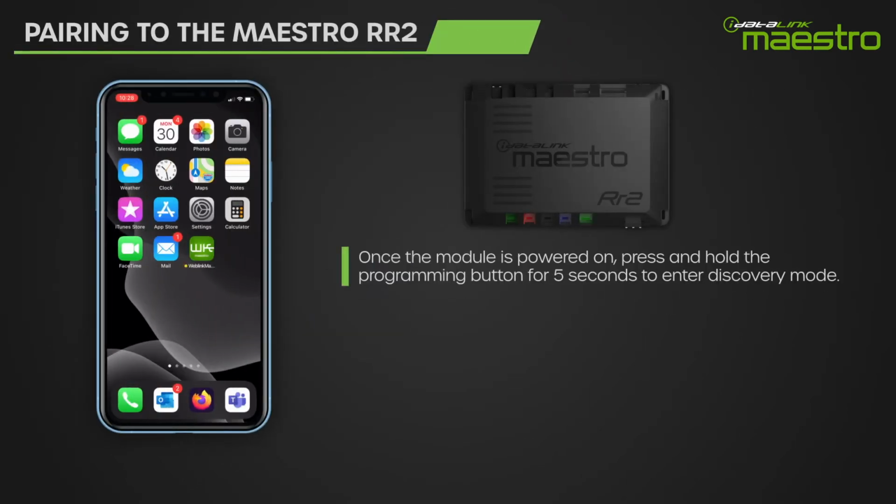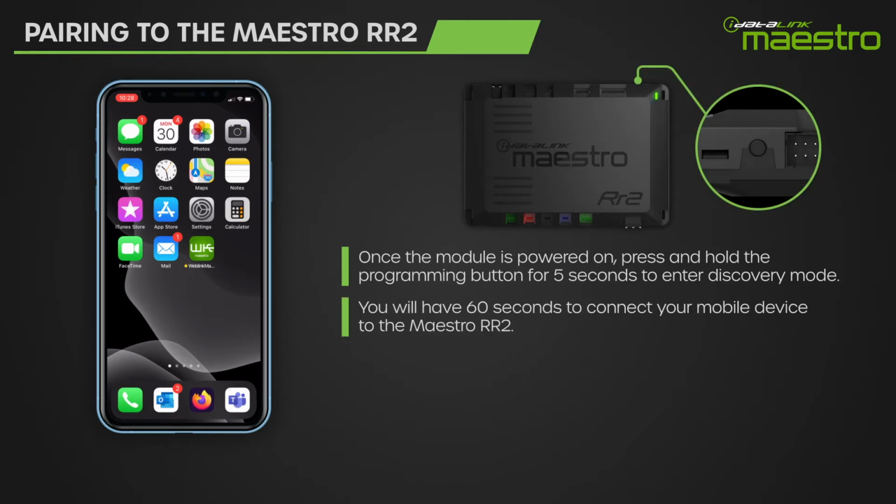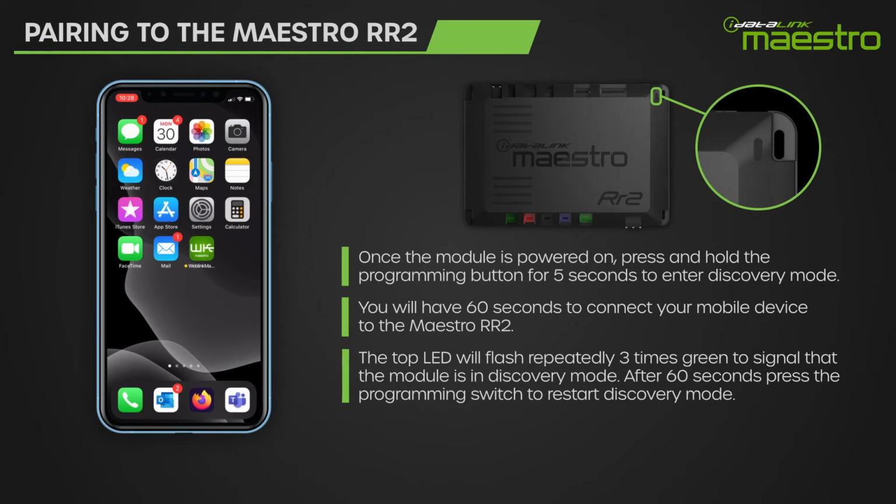Once the module is powered on, press and hold the programming button for 5 seconds to place it into discovery mode. You will have 60 seconds to connect your mobile device to the Maestro RR2. The top LED on the module will repeatedly blink green 3 times to signal that it is in discovery mode. If 60 seconds has passed, simply press the programming button for 5 seconds to reinitiate discovery mode.